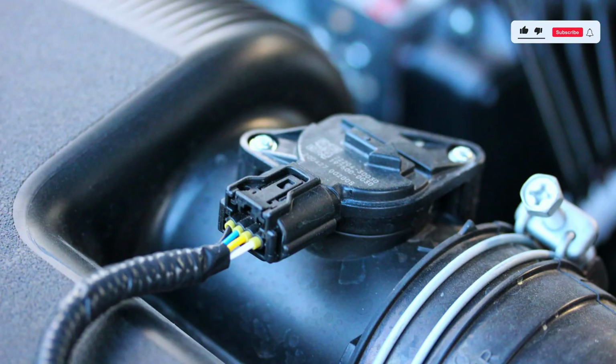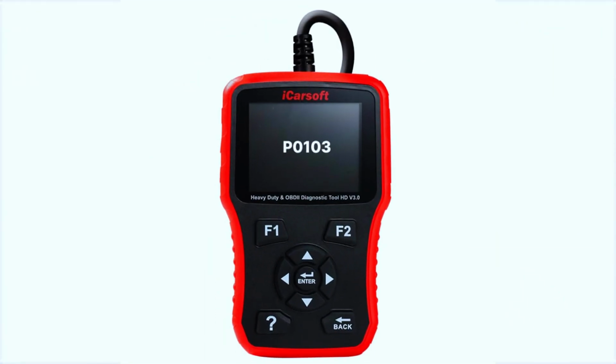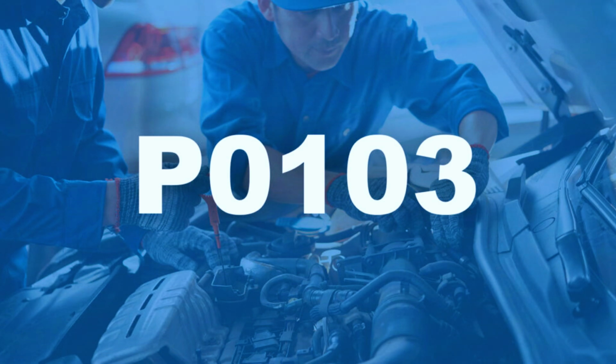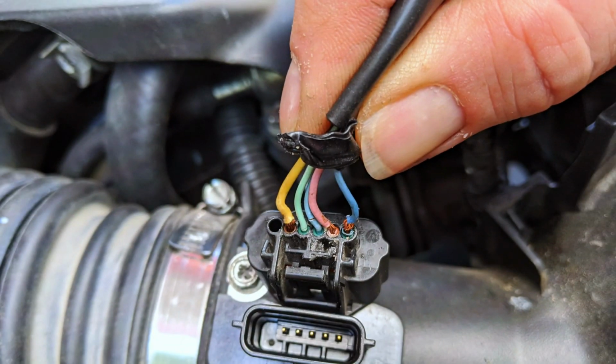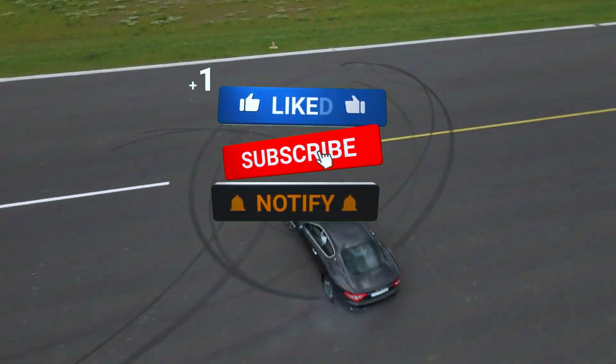After you've gone through each of these steps, reconnect everything and start the car. Use your scan tool to clear the P0103 code and see if it stays off. And that's it. Fixing a P0103 code can be straightforward if it's just a dirty sensor or a loose wire. Hopefully, this guide helps you save a trip to the shop.